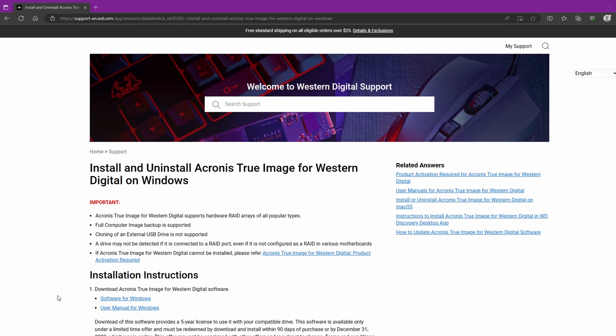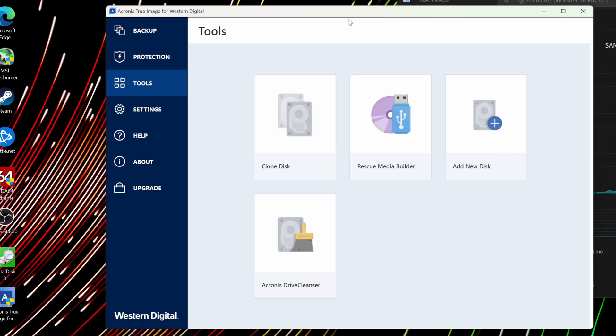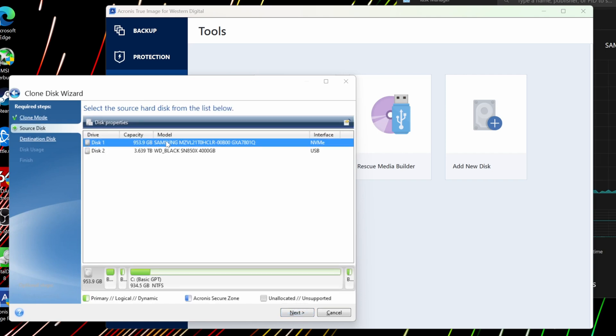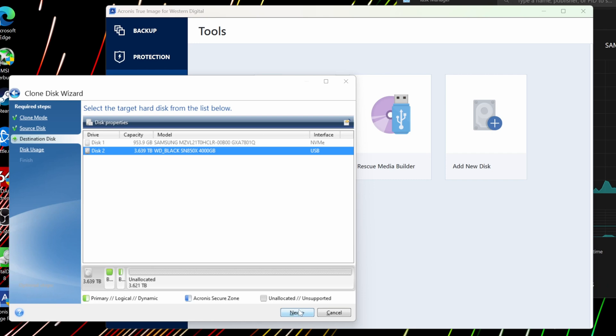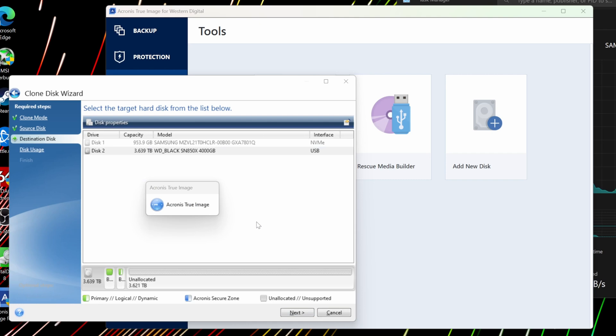We need to go to Western Digital's website and download the free copy of Acronis True Image for these Western Digital SSDs. I'm going to put the link for that software in the description as well. So install and then open the Acronis software and we're going to choose the disk clone option. This is very straightforward - you follow the prompts. First, you're going to choose your source drive, which is obviously your C drive in this laptop. You click next, and then it asks you for your destination drive, which is your SN850X. Ignore the fact that my SN850X has some files on here - I actually cloned this twice just making this video. Yours will have nothing on this drive if you bought it fresh.